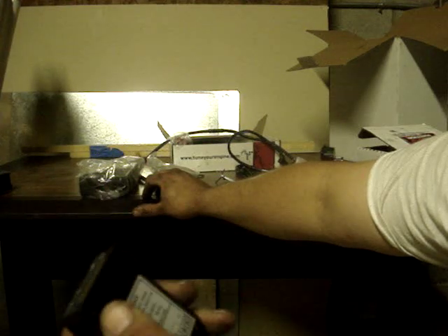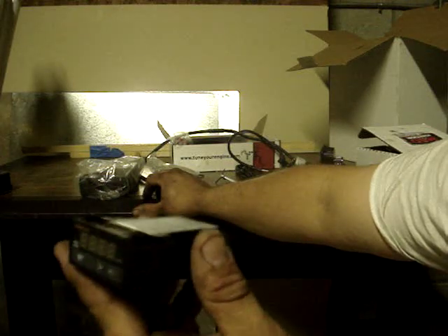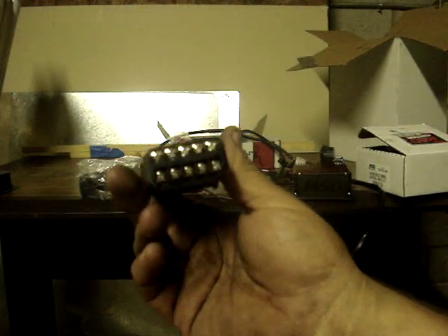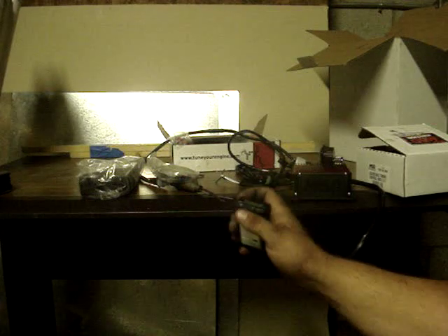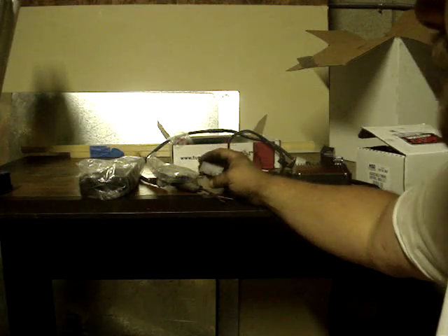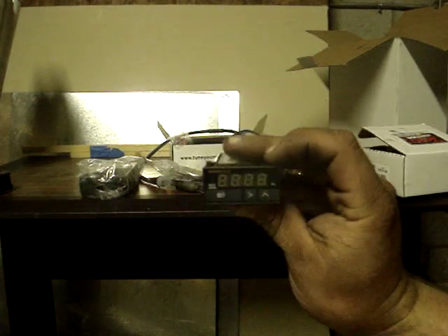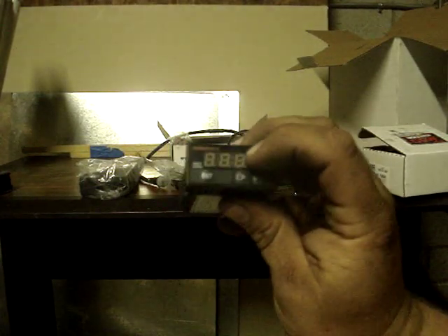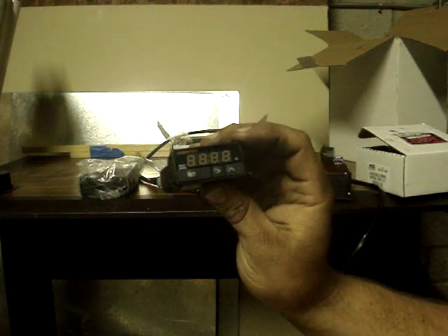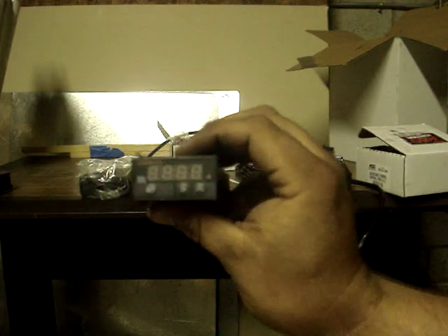This is a very universal solution. It'll work for anybody's setup, not just a dry cell, but anybody using signal modifications. Right now I'm working on getting a universal wiring harness for this, and this setup will be about $135 with the wiring harness. The only downfall is it is a digital readout, so it'll bounce around quite a bit — 20 or 30 degrees on your last two digits. You'll have to RMS it in your head; personally I'm going to have a buffer through the laptop so it'll average it out for me.